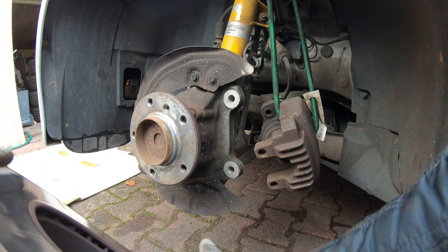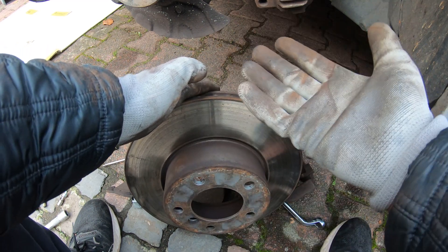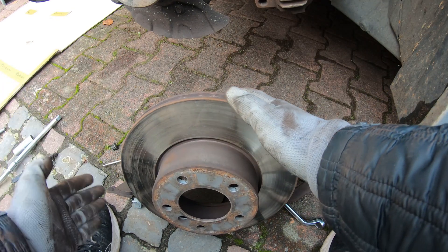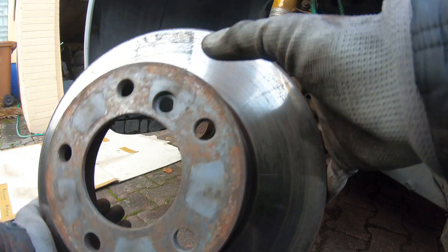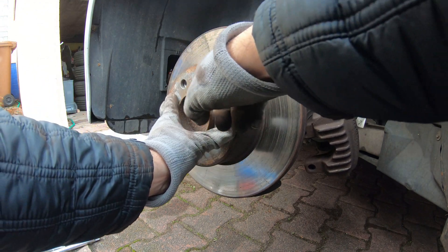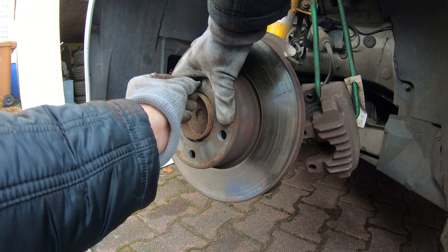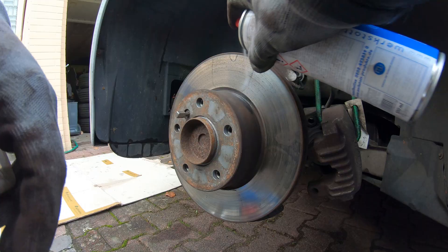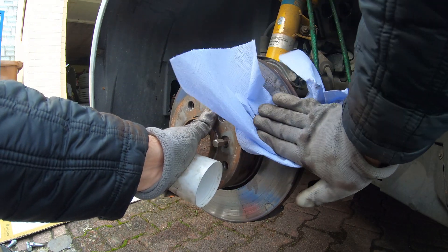These rotors are super heavy. Everything looks to be in good condition. With your new rotors, brake-clean the heck out of them and clean them up totally — put on new gloves so you don't get any contamination on there. I'm not replacing my rotors because we measured and confirmed they're fine; I just want to show you how to do this. Line up the center of the rotor to the center of the hub, then screw in your rotor retaining bolt. Wire brush everything, put a little ceramic brake paste on the back so it doesn't stick, brake-clean everything — everything needs to be super clean.